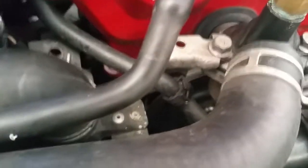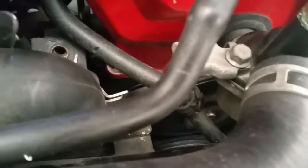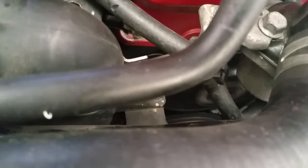There it goes, dropping it in. Let's check the timing again and make sure the operating temperature isn't changing. There it is right there — the green little dot down there, that's nail polish. Looks like it's sitting a little bit above where I want it to... no, actually that's just an optical illusion on camera. It's sitting about 14 and a half — I think we're good. Check the idle one more time.